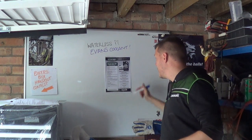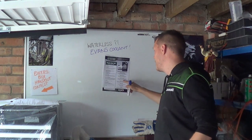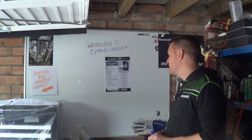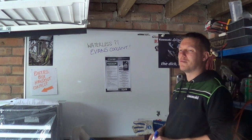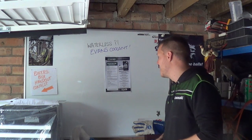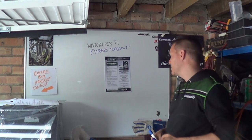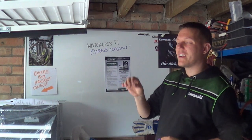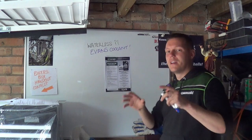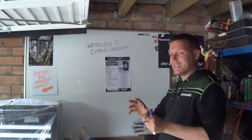What reduces strains on your engine hoses, cooling components and so on - prevents corrosion. Water promotes corrosion via oxidation and electrolysis. I wouldn't say water promotes it - it makes it sound like it's going out of its way to do it on purpose. Evans waterless contains no oxygen and is virtually non-conductive, effectively preventing corrosion. You've got to be very careful what you say there - 'effectively' which isn't completely. There is some acid formation, we'll go through that in a bit. There are other things this stuff actually does which, in a sense, you could almost say is nearly as bad as just running water.